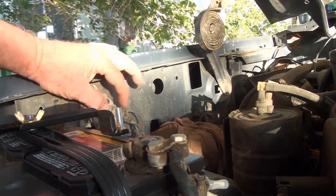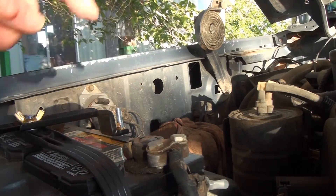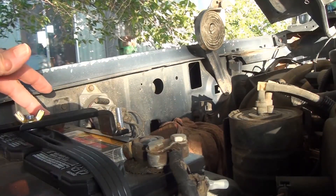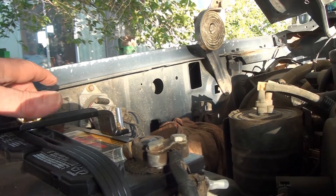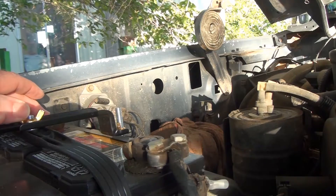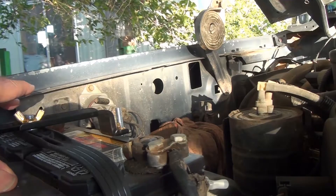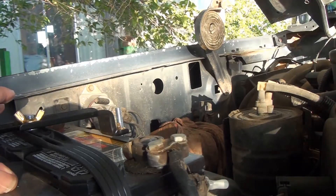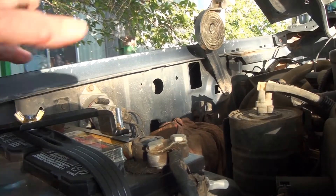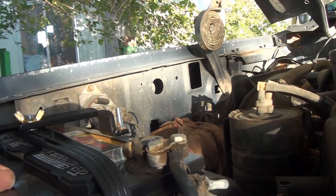But actually, I'm not going to jump across these two right now. That's not the first thing to do. The first thing you should do is check your battery cables — make sure they're not all corroded. A lot of times that'll cause it not to have enough amperage, with corrosion keeping the battery terminals from connecting properly. And then you want to test your battery. If you've got a very weak battery, charge it and try again — maybe it'll start. So first, check for corrosion, check your cables, then check your battery.